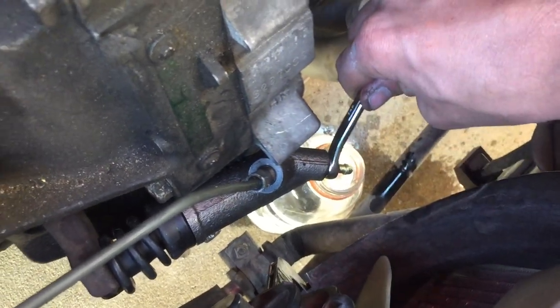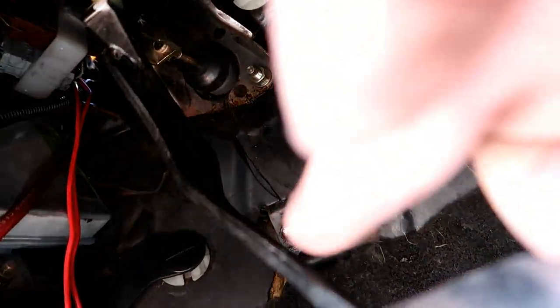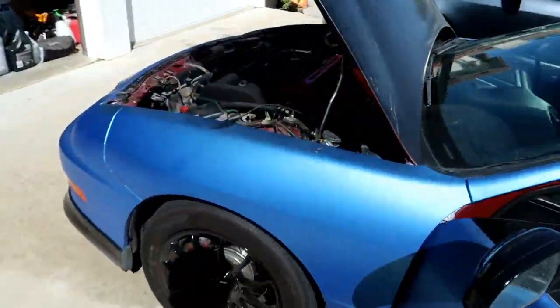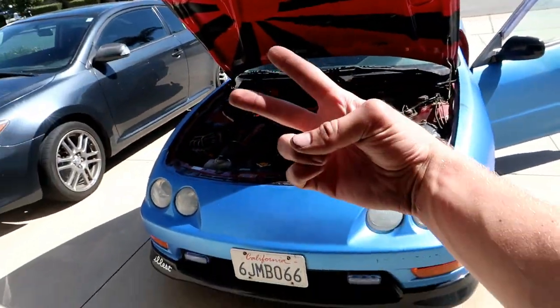Close the bleeder. You might also have to adjust the little pin where you put the cotter pin back in so your pedal is in the same position. That is basically it guys — that is how you replace a master and slave cylinder and bleed it afterwards. Hope you guys enjoyed it. If you did, make sure to leave a like and subscribe if you're not already. See you guys in my next video!